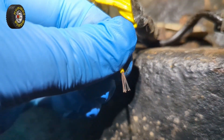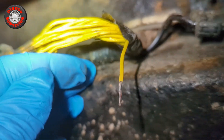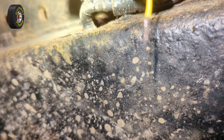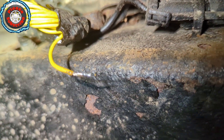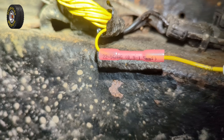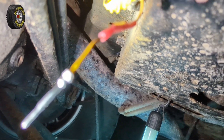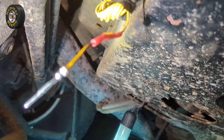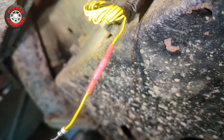I'm cleaning every single strand until I get that copper look and it's nice and shiny. I'll try tinning again where I failed before. I think I've managed to get enough solder on for it to tin. I'm now going to put the joint together - I've got the soldering heat shrink ferrule in place and I'm running the heat gun over it. I've done the joint but there's no way of knowing if it's actually soldered inside. The heat gun is one I use for printed circuit boards so it definitely gets solder hot - I'll give it a test.